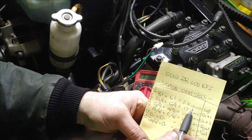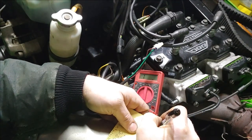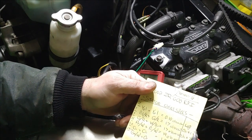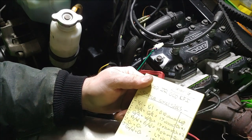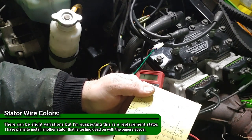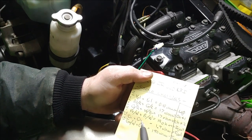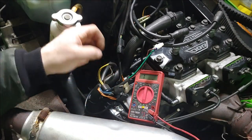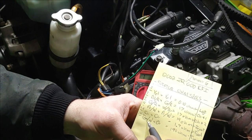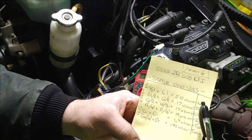Here's the thing — I got these specs out of the manual for the 2002 ZR 600 EFI, but I'm going to go check if any of these wire colors line up with other entries in there. Because the only colors that actually matched were yellow to yellow and orange to orange. For example, the spark trigger is supposed to be green and white and brown. So I'm going to check that out in the service manual and go from there.